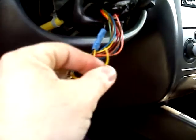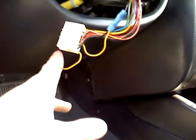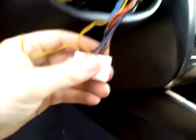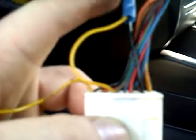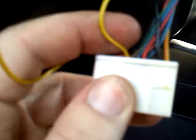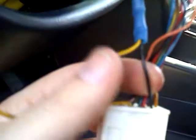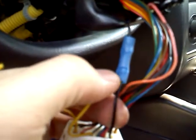This wire here and this wire here are going to be looped together. All you have to do is take wire cutters and cut that wire in half. This part right here is no longer useful. Then on the back of the connector, take the other wire that you cut and look for a black ground wire right here where I'm pointing. You're going to splice those together — this pin right here and the black one. You can crimp them or solder them in to make it look cleaner.